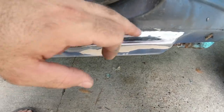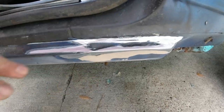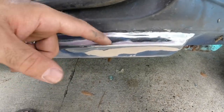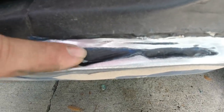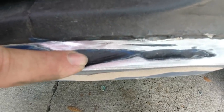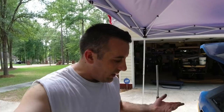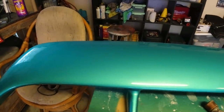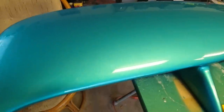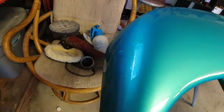This is what we're left with — some pretty big craters here. Like I said, we'll put a very light skim coat in; you have to scratch this up too so the paint has to be sanded or completely removed for the bondo to stick. I'll actually probably use fiber fill on this just to make it good. By the way, we've wet sanded and buffed out the spoiler and it looks really good. I actually had to blend this corner last night because I chipped it, but I think it looks pretty good.